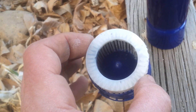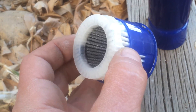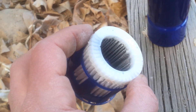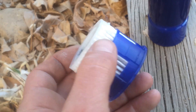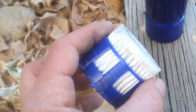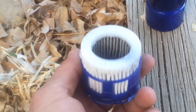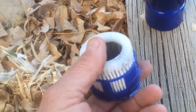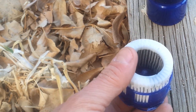As these little balls come down from the second filtering stage down to the third, they get caught inside the little holes and clog the pleated filter entirely. In other words, this filter is designed to fail before it can ever reach, under normal circumstances, anywhere close to its full filtering capacity. And this is how P&G and its competitors in the water filtration business make sure that they can sell you more of the consumables than you really need and would otherwise buy.